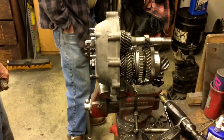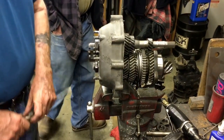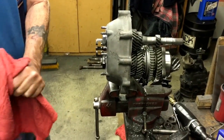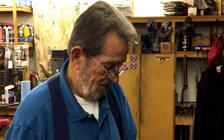Slam shifting into second. All this 6-volt stuff sucks. It's 2 millimeters thinner than the 12-volt gears. And Volkswagen improved as they went through the years. That's why when I do a 6-volt, I change everything internally to 12-volt. But it's getting harder and harder to find that stuff that's not from Brazil or from Taiwan.